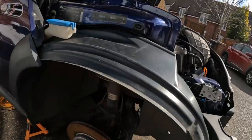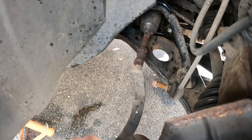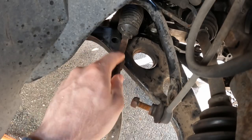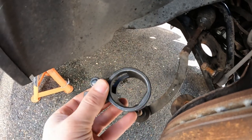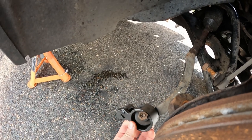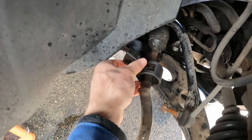So what we're going to do now is attack — and I do use the word attack on purpose — these tie rods. I'm replacing the outer and the inner. These are also going to be seized on this side. It was suggested to me by John, and it was an amazing idea, that using this tool here for the inner tie rod you can just slot it over and get it all the way down to the end and basically take off the inner tie rod without having to do any of the other malarkey.